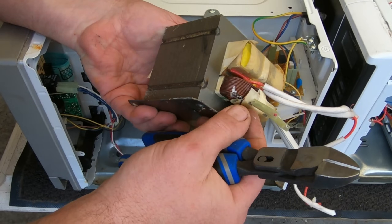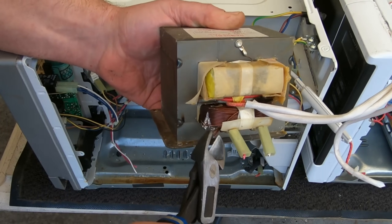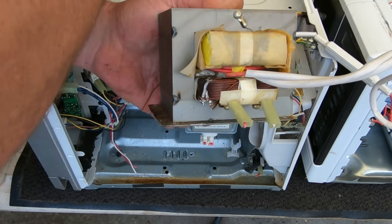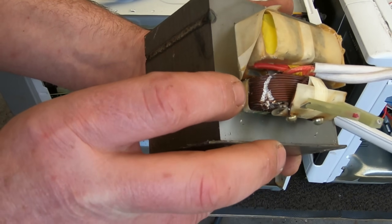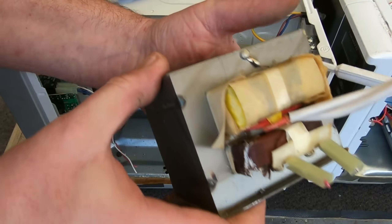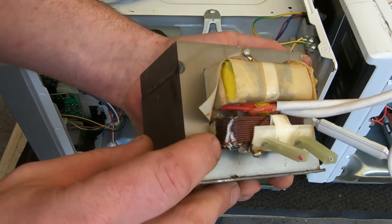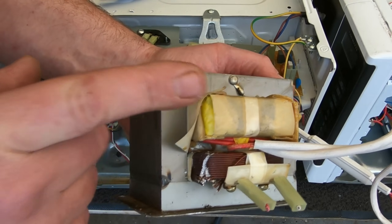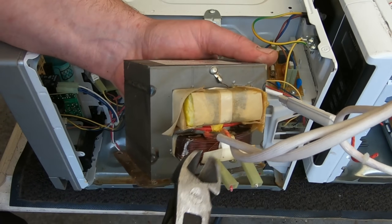Because I'm scrapping this out anyway it doesn't matter — I know this is damaging the transformer but I'm not using it. As you can see it's a silvery color, so that means this is aluminium. Most likely the one on top will be copper. You don't find aluminium much unless they're really cheap, like forty dollar microwaves. Because this one is aluminium, there's no point busting it apart to get that little bit of copper — you actually get more value just selling it as a scrap transformer as-is.